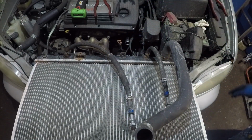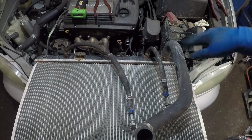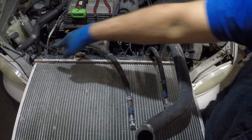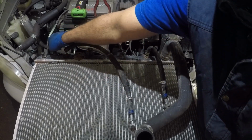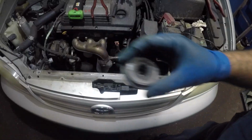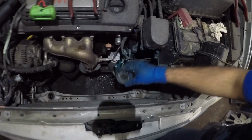We have the radiator out, and we'll put the next one in. I'm going to be swapping these hoses. Just swap all three of these hoses, put the sensor in the new one, and make sure the valve is closed on the new one, and we'll drop it in there together. Alright guys, don't forget to take off the mount of the old radiator, because they're going to go right down there. Sorry, my camera flipped. So they go all the way down there in the bottom below, one on this side, one on that side.